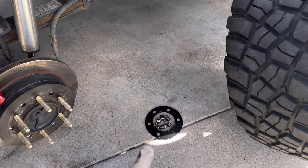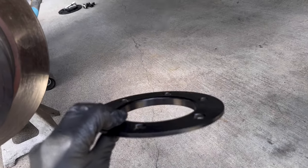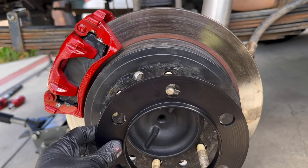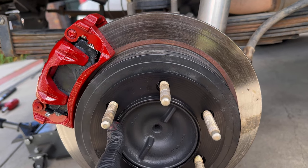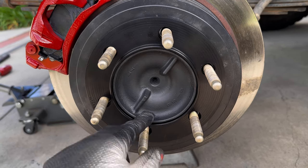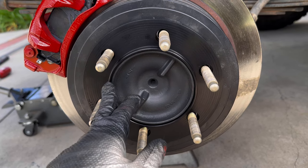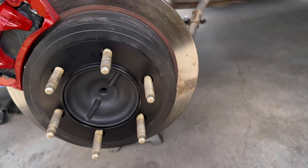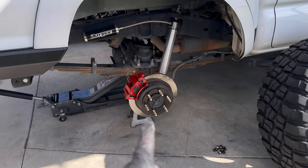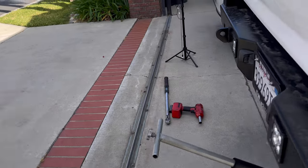We have the new 5mm spacers with the hub-centric ring that are gonna go on. So this will be 106mm for Tacoma, and it's going to be wider, 112mm, that will go up to the TE37, and there won't be any balancing issues to worry about.